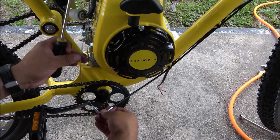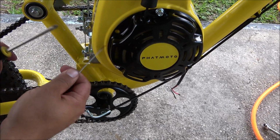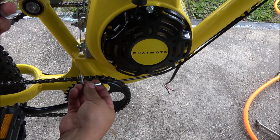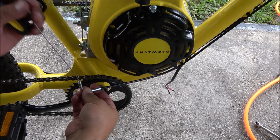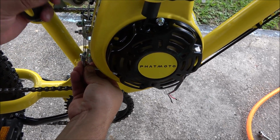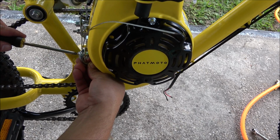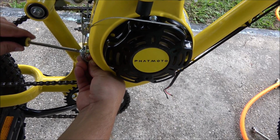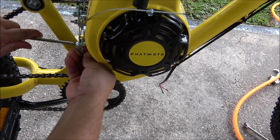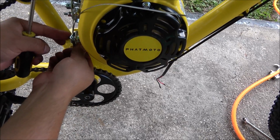To connect the throttle line, go ahead and run it through this little bracket here with the Phillips screw. Make sure that it is loose enough. And then this metal piece, this elbow, is going to get pinched right there. So you pass the line through, you hold it in place, you tighten the bolt, until it doesn't go any more.